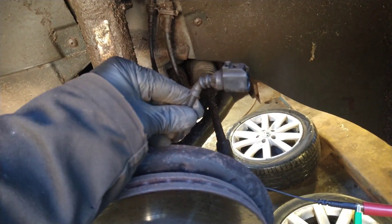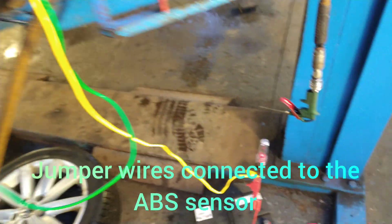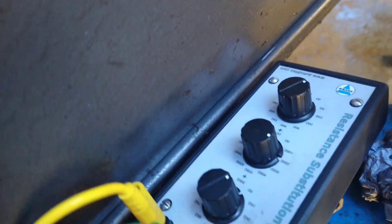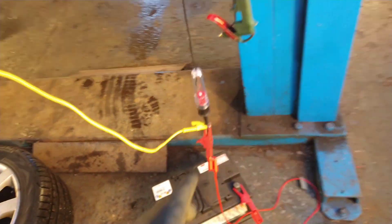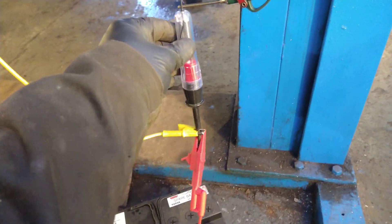So I've disconnected the car, and I've got one wire going through a test light, and in parallel to the test light I've also got a 200 ohm resistor going across it. So that's in parallel, basically going across that wire. It's not very tidy the way I've got it wired in, but that's all it's doing — parallel to this.